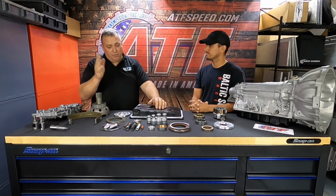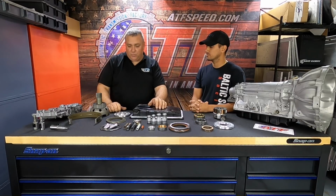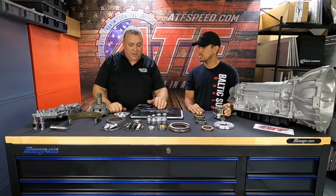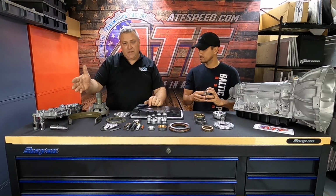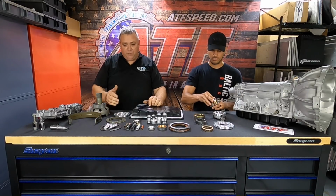You know what I mean? So there's over 100 psi of sweep in that solenoid. It makes a huge difference in the way the transmission works, the way it shifts. So what we try to do is, anybody that has an AEM and wants to send us their tune, we'll make the changes for you and send it back. Or we can send you a picture of a graph that we've done before and try to show you how to set up your TPS and duty cycle for that solenoid to get the pressure to be where it needs to be.